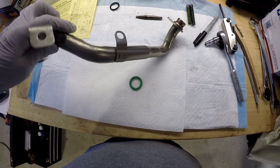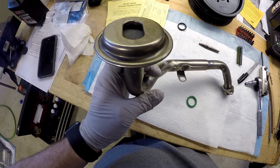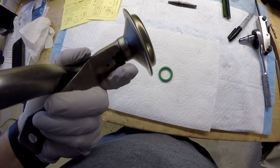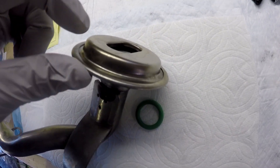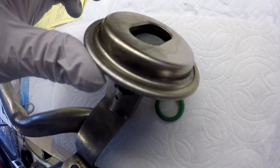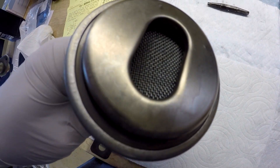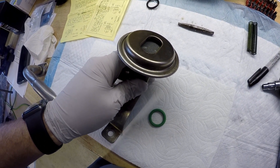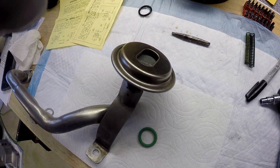You don't want to damage your engine when you lose oil pressure. So how I cleaned this was I got some brake cleaner and flushed it down inside there — I used quite a bit. I actually sprayed the brake cleaner down inside all the way around between the screen and the outside housing, and I got quite a bit of junk out. I was surprised — it was covering the screen a little bit. It looked like dried out Loctite but I'm not sure what it was.